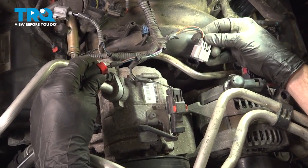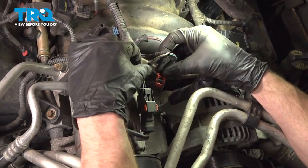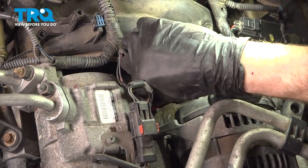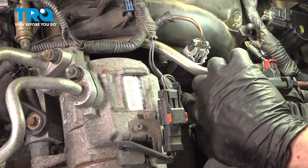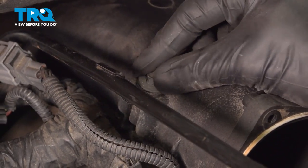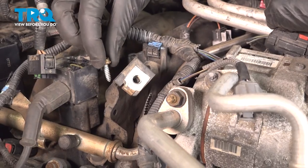Reconnect your AC compressor. Make your way to the MAP sensor. Now we'll make our way all the way down to the coolant temp sensor — it's hard to reach. Lock it in with the red locking tab. Now let's reattach our oil dipstick tube. Let's move to the front passenger side of the intake and reinstall our plastic bracket. Get that in position, start in our 10-millimeter headed bolt and snug it up.